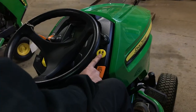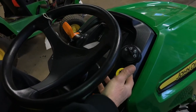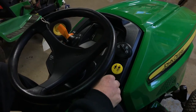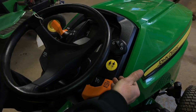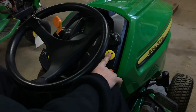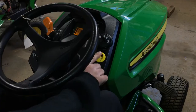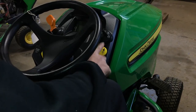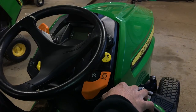As far as the power takeoff — this yellow button is what actually starts your mower deck. I'll normally start the mower deck at about half to three quarter throttle, depending on the time of year. You don't have to run at full speed to start the PTO because there's so much torque from the engine to the mower deck starting from ground zero. I usually keep the throttle at about three quarter position, pull the PTO lever up, let the mower deck run, then put it all the way up to fast speed and away you go for cutting. Remember, if you turn off your machine and forget to push this button in, your machine will not turn back on. If the PTO lever is out, it won't crank — so turn that off before you get off the machine. It's also a safety factor: you can't get off the machine unless this is pushed down or it shuts off the machine anyway. So there's a lot of safety involved. This is your basic operation on an X350 John Deere. Thanks for watching.